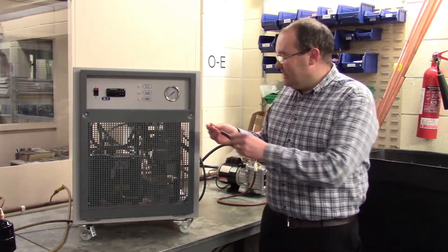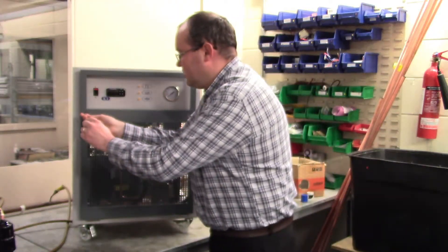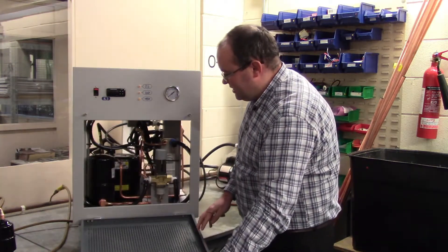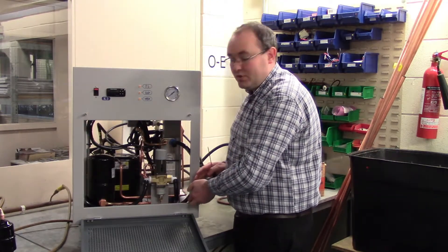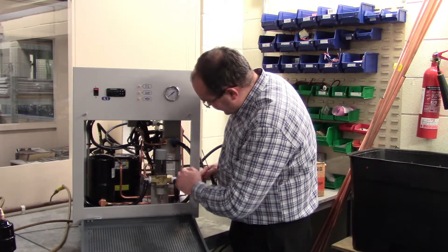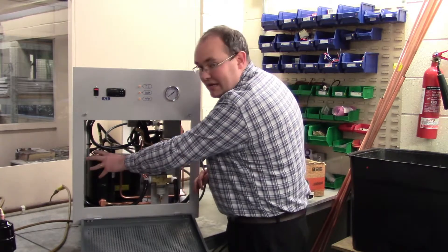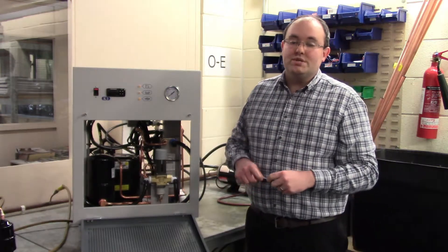If we take the front lid down on the K3, we can see that this unit, using exactly the same enclosure as the air-cooled K3, is missing the large thin tube heat exchanger here, which would have been the condenser heat exchanger. We have gained a secondary brazed plate heat exchanger, a water regulator, and a liquid receiver — all parts of a water-cooled fridge assembly.